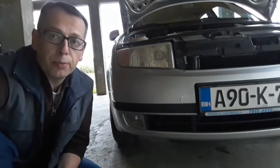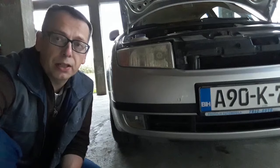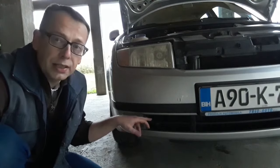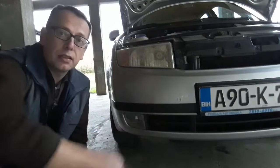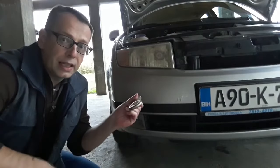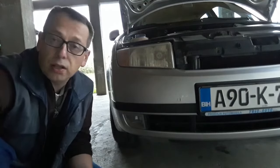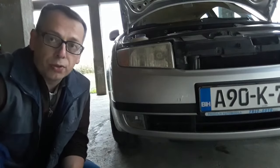For a brief recap: first, go to the spare tire compartment and search for the towing hook. After that, take it out and find the location where the thread is. Take off either the plastic lid on the bumper, insert the towing hook, and screw it in. If the towing hook is welded to the car — like on the backside of the Skoda — all the better. Then just insert the towing cable and you're good to go.